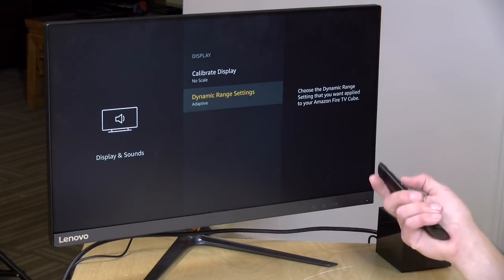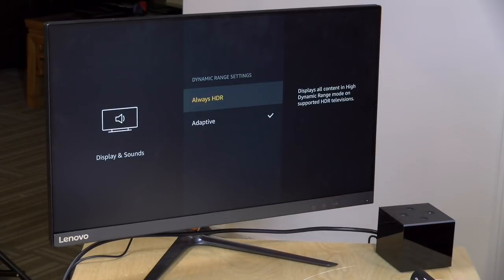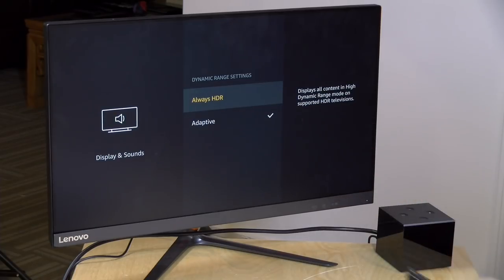The second thing you need to do is go to the Dynamic Range Settings and set the HDR to Adaptive. The reason is that if you have it set to the default — which is Always HDR — it will leave your TV in whatever the highest HDR mode was detected. On my TV upstairs, it locked it in at Dolby Vision even for content that did not have Dolby Vision, and content without any HDR at all was also stuck in Dolby Vision mode. Clicking it over to Adaptive will allow the device to switch back and forth, and it was able to do so successfully with my LG OLED. YouTube at 4K also worked successfully. 4K 60Hz content ran just fine, like it did on the Fire Stick 4K as well. All in, a very good overall media experience and the voice command is pretty cool.